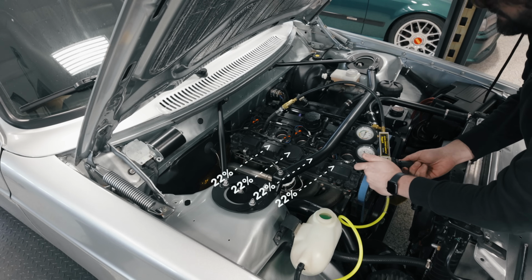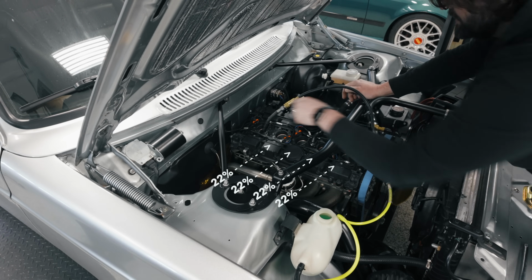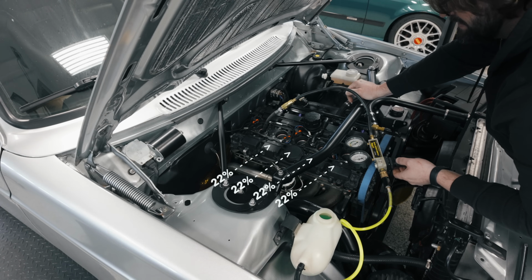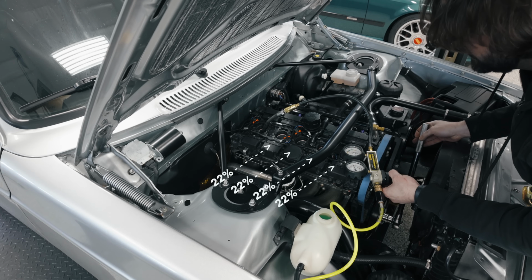At first, I thought this might have been because of an error that I made in rotating the crank, so I tried again a few times to rule that out, but I got the same result each time. Cylinder 5 showed very high leakage that gradually reduced with more pressure applied.